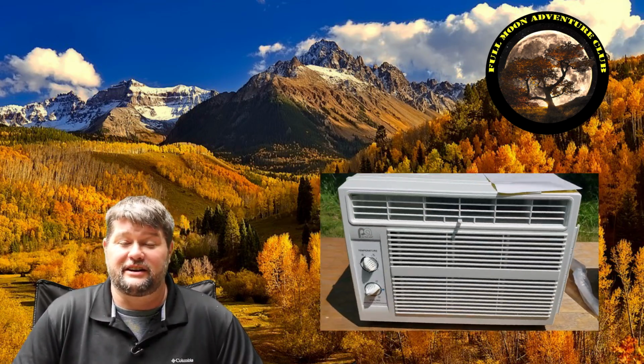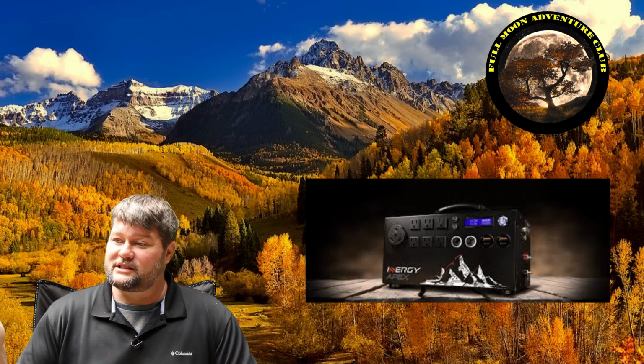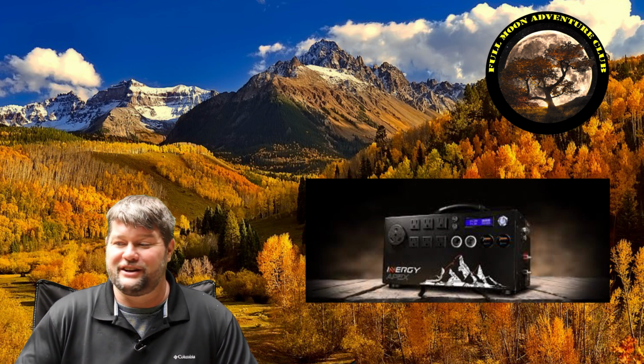So I really like that this guy can run washing machines and refrigerators and even a 5,000 BTU air conditioner I ran for hours on the Kodiak. This will handle that because it only uses around 500 or 600 watts. So that's an impressive amount of energy to be able to use on this guy continuously every single day for 5.5 years until the batteries are only charging at 80%, and you could use it for years after that at under 80%. I think that's really impressive that it can do all of these things: the power tools, the refrigerators, the large appliances, and even an air conditioner.